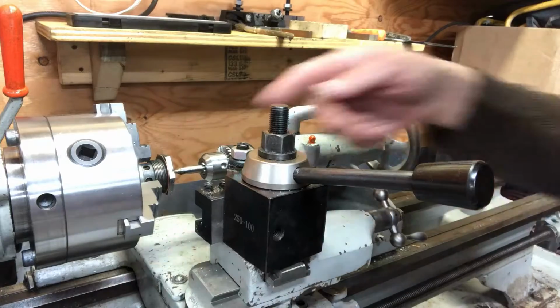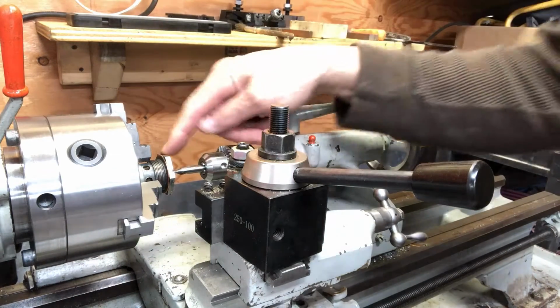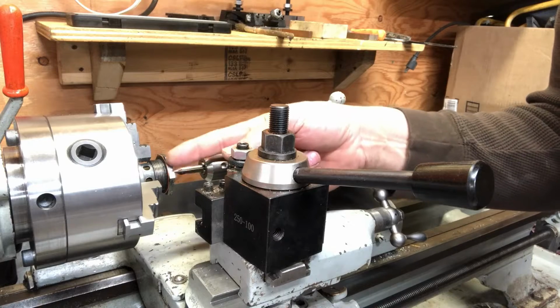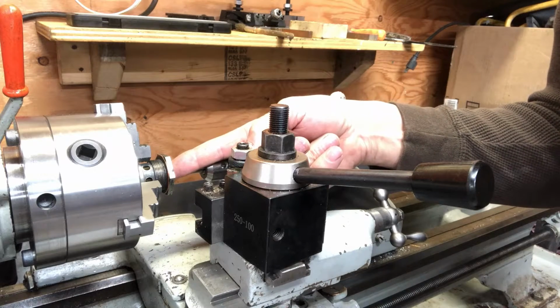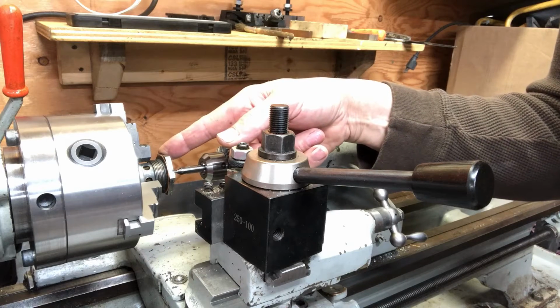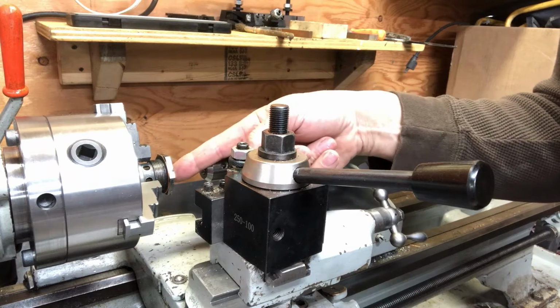This is the crankcase drain plug in here, and you can buy them on eBay with a bolt. I think they're stainless steel, and then they got a bolt tapped into the end here so that you don't have to undo this great big plug every time. If your bike sumps, you can just undo a little bolt in the center.